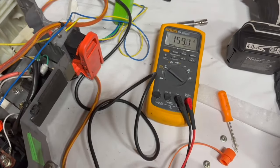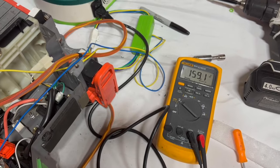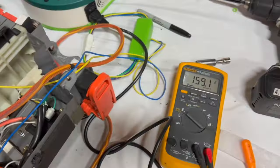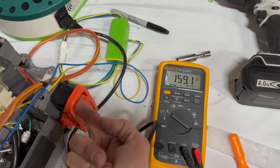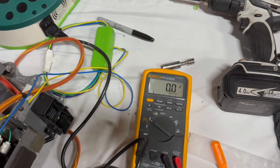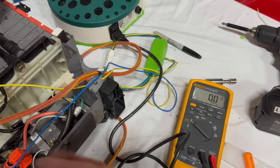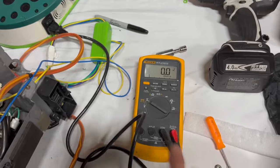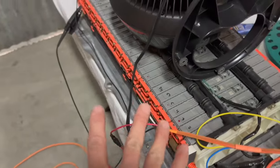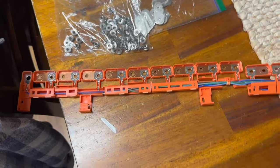There's a lot of misinformation online about discharging the high voltage battery. Let me show you exactly what happens when you release the service plug. The meter is hooked up positive and negative. The first click disengages the interlock — and when you pull it, boom, it goes right to zero immediately. It splits the battery in half; there's no longer a connection between the two halves, so there's no dangerous voltage at the leads. It's an open circuit.